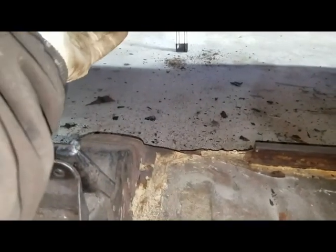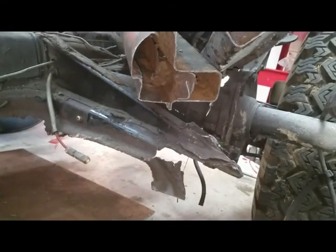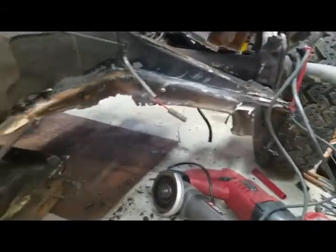Next I'm going to take all this old frame rubber seam sealer out and then slowly grind out all the metal. One thing I hope I didn't mess up is under here — I hope I didn't cut too much. But if I did, I'll just weld and repair it. I don't like this corner here either, but we'll work on that. That was all kind of welded together with some bad repairs from the prior owner. I took a wire brush and wired down some of the rust along here. You can see another bad old repair — I'm going to grind that out. I'm going to take the grinder and start grinding out some of these press welds and spot welds to get this out cleaner.